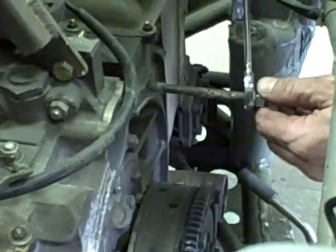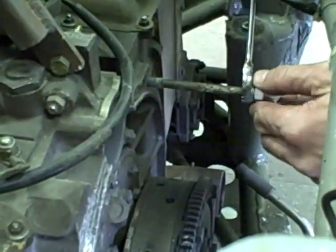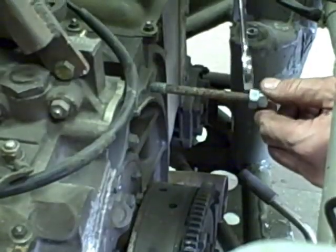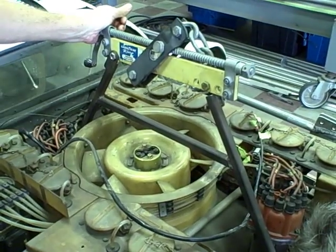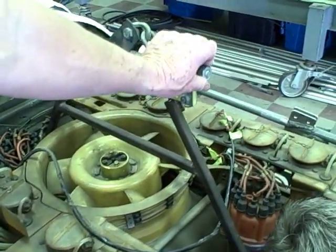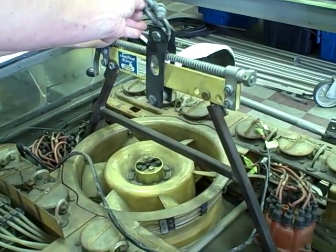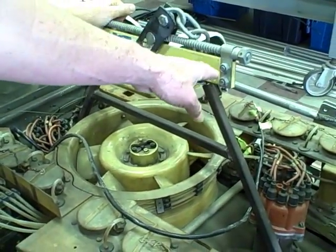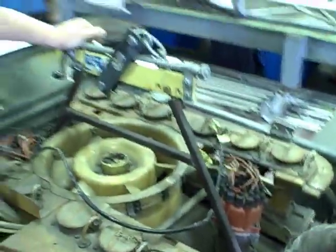You can see they come out with heat. If you didn't put a little heat on them, they wouldn't come out. In a few minutes, as we get the hoist hooked up, we'll hook up to this little beam, which is adjustable. It has a little crank on it to change the angle of the engine so it clears the front of the cockpit and these back pipes. You can see the adjustment right here moves this pivot center back and forth, which changes the angle of the engine. We'll take a little time to get these studs out and then come back.